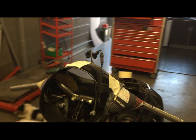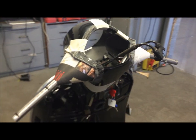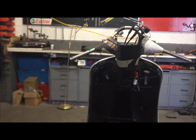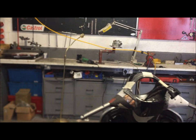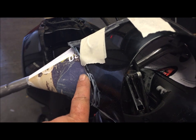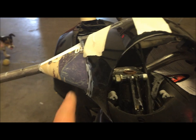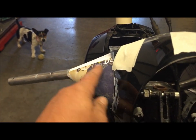We're looking for a blend — something like that — which will blend nicely from the plastic into the steel bars. Essentially, what we're going to do here, we'll use some epoxy to get this edge, put an epoxy coat over this — this will be stronger than the actual plastic. We'll then do a resin fill and smooth this transition from plastic to steel in filler.